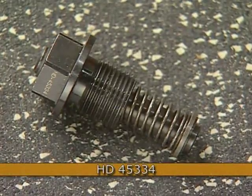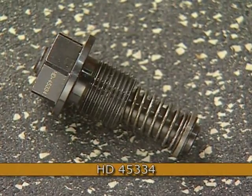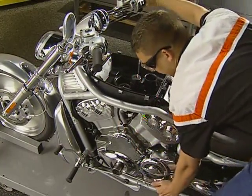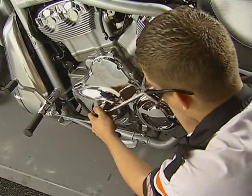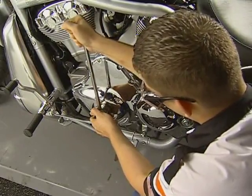If, after installing and prepping the engine, you notice a rattle on the vehicle startup, use this tool to inspect the condition of the secondary cam chain tension. With the airbox cover, filter, and horn removed, rotate the engine in a counterclockwise direction while observing the front cylinder's intake valve through the intake port. When the intake valve closes, turn the crankshaft an additional 90 degrees.